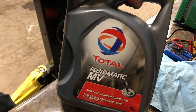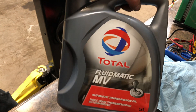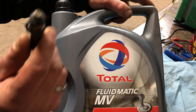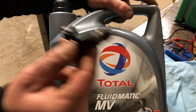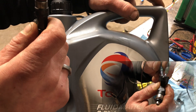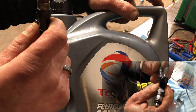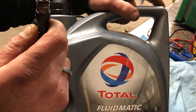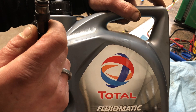If all your tests come back okay, here's what works for me. I take transmission fluid and dump some in a dish. I take the injectors and soak them in transmission fluid for at least a couple of hours. While they're soaking, you can also do the 12-volt open/close test repeatedly — it helps lubricate everything inside. After soaking, take a blow gun and air gun and blow them all out.